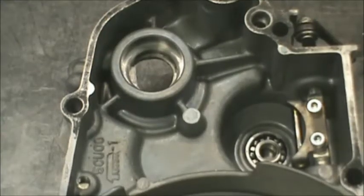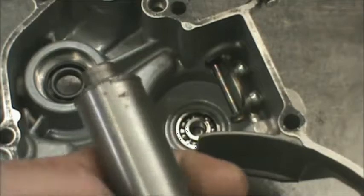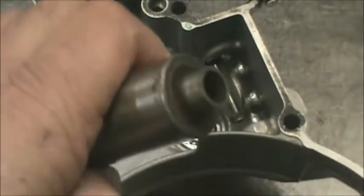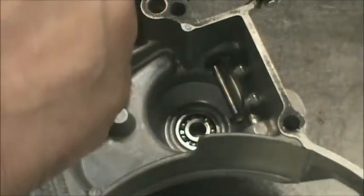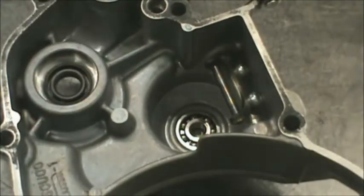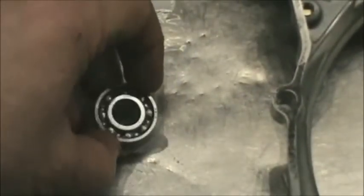I'm going to wash my hands and be right back. There's that first seal in where it goes. A lot of times we have special drivers that we use for this — we actually make them if we need them. I just put it inside the seal and push it in there until it's flush. Next thing I'm going to do is drive the new bearing in. It already comes with some oil on it — actually grease — and I'll get that thing put in next.